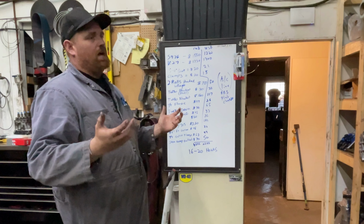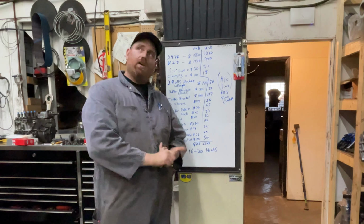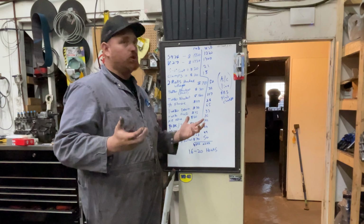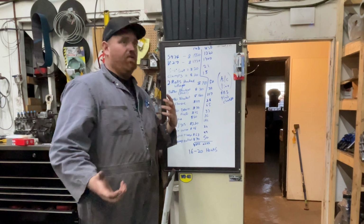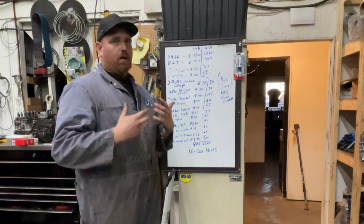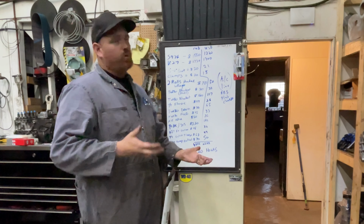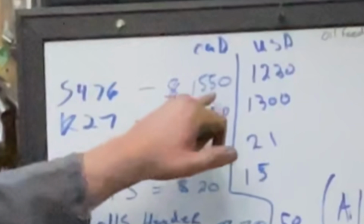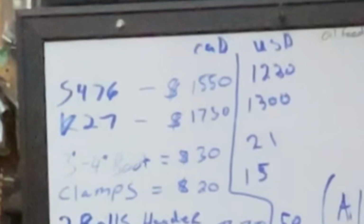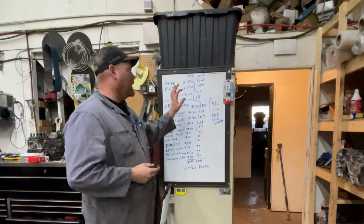But like you could use a VS Racing, or what's the other one? Pulsar. You could use one of their turbochargers, do an S472, an S475, the 87, 82 with a 0.9 housing, and they're like $400 or $500 US. So you could do that turbocharger if you wanted to cut the price of this turbocharger down. The K27, the price is kind of the price because that's what you're buying. Now that being said, you can buy the K27.